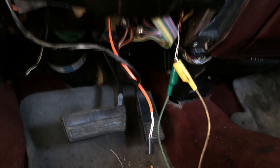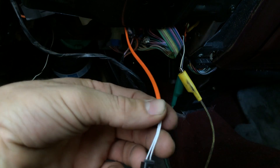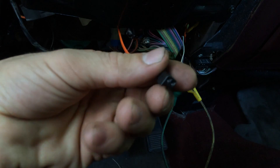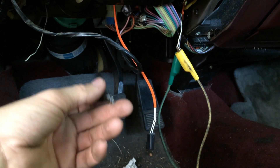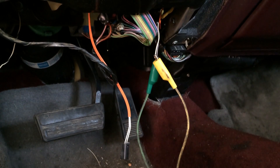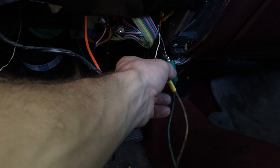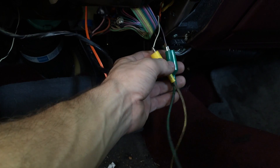In the vehicle, you remove the sound insulator or kick panel, and there's an orange wire. It actually has two wires inside of it — the orange is just an insulator — and there's a plug right there with the male side for the terminals and a female connector with male terminals. I went ahead and cut it right there where you see the two jumper wires, because I was planning on bypassing it anyway. I mean, if somebody steals a 98 Lumina with a quarter million miles on it, they've got bigger problems. I took two jumper wires with alligator clamps and clamped them onto the wires after stripping them back to expose them.